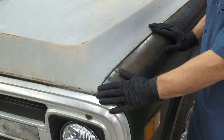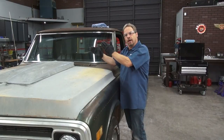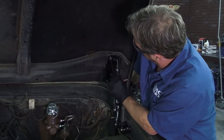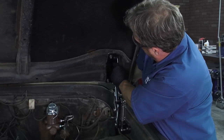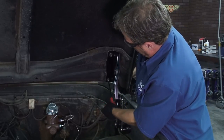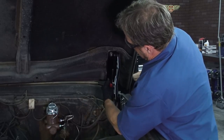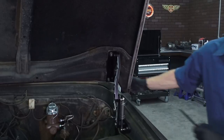So now we've got some adjustment to do. I'm too tight here and it's wide on that side and narrow on this side — so that tells me the whole hood has to turn that way. But you've got to think about it differently with the hood up, because the hood has to go up on this side instead of forward. Think about your geometry lessons in high school. So I'm going to loosen this off while I'm supporting the corner of the hood and just try to bump it. It moved maybe an eighth of an inch on this hinge on the top. Snug it back down and we'll try it again.